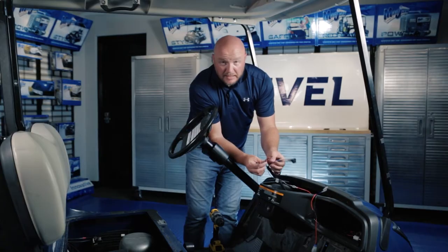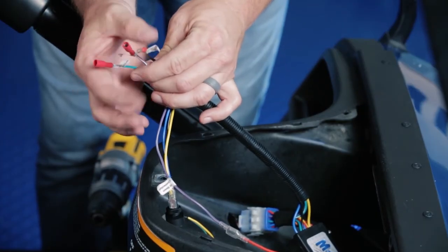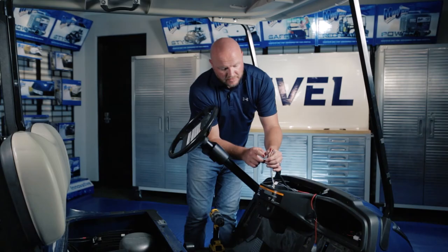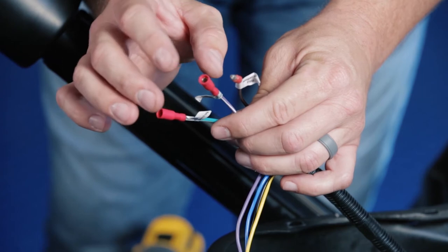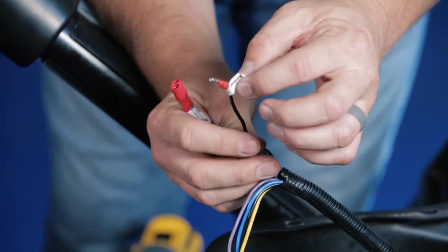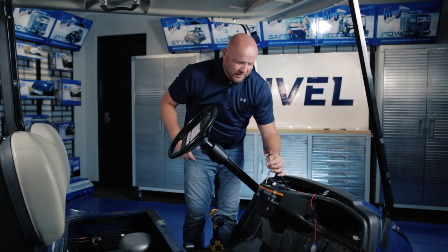At this point, if you're using any additional fog lights or front light bars, go ahead and attach them to your fog positions now. You'll see a green and white fog light and a second position fog light, which is a purple and white. What you'll do is put each one of your light connections' hot wires here and then put the negative for each one to this negative fog male bullet connector here. That'll again work off of the indicator.